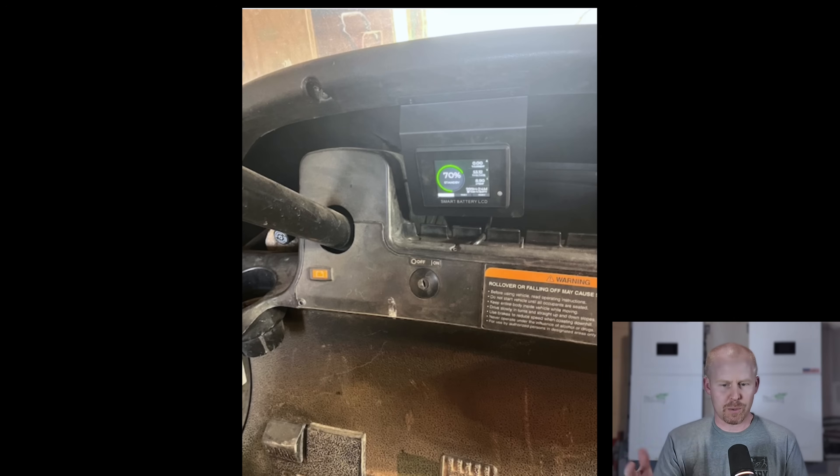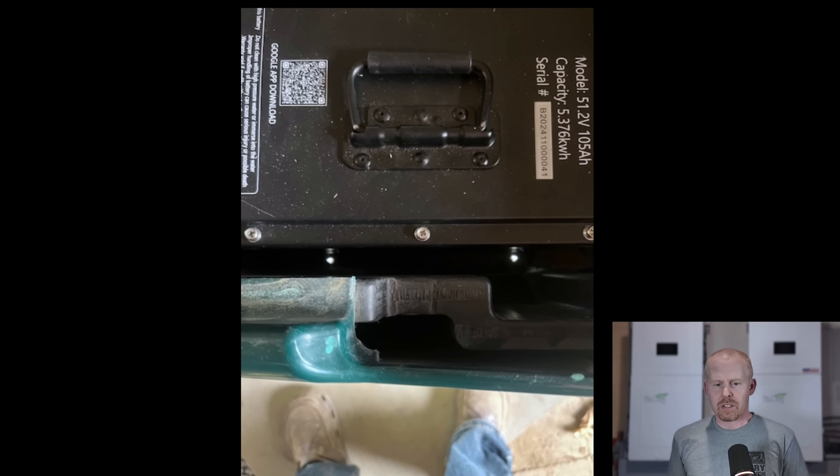Now, a rough installation description. Use your own safety and protection protocol when handling and wiring this product. This install includes solar panels and a charging station input through a secondary charge control device — the same style and function as used with the Crown lead-acid batteries, but with a lithium voltage protocol. There are two groups of solar panels attached. The design of this battery, as a potentially portable power supply, uses a master button to turn the battery on and off, which disconnects the power output on the positive and negative main posts. If you're using this with an additional solar charging controller, attention and care need to be taken, including a user change of habit, to prevent destroying any attached solar charge controller devices.